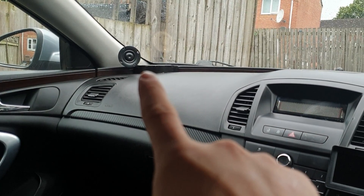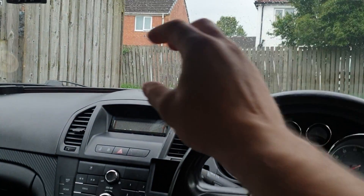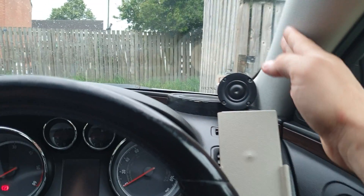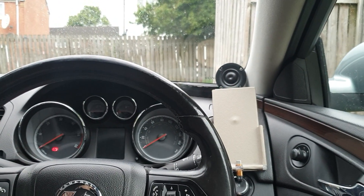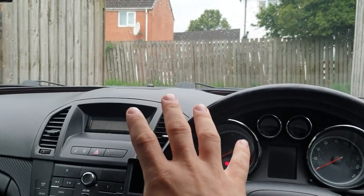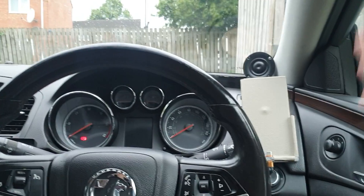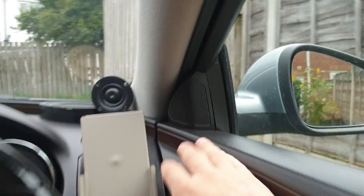My take from comparing the three-way with the two-way: it's not a fair comparison because the main system tweeters are aimed towards you, whereas the two-way tweeters are totally off axis — probably around 60 degrees — and that diffused center I imagine is caused by reflections from the glass. This is similar to what I noticed on the Nissan Qashqai install with the Dynaudio Visteon DSP, where I also had something not quite right with the center — and that install had everything aimed toward the side. I think reflections play a big role.